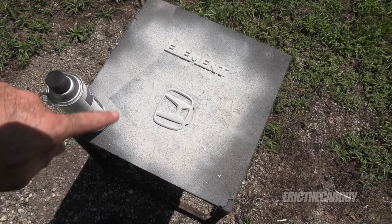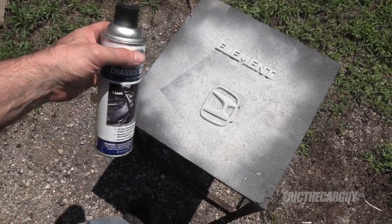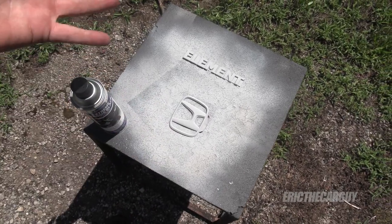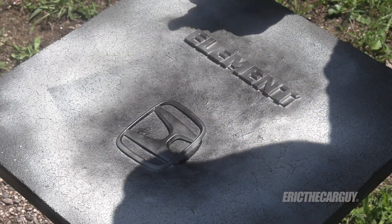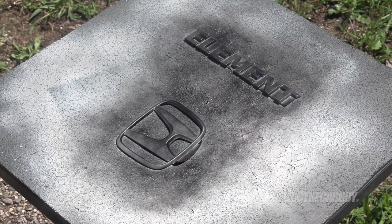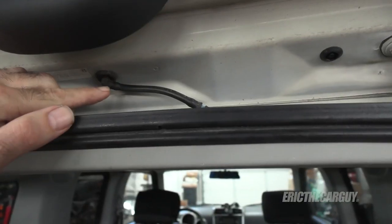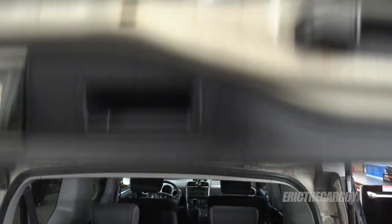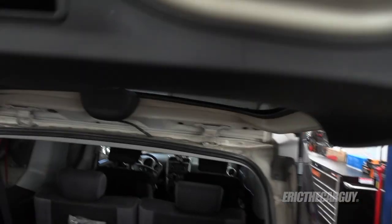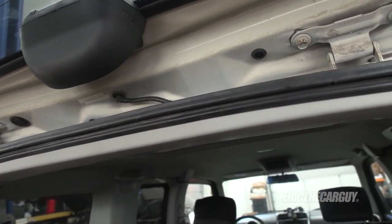In between doing that, I came out here and put another coat of primer on and everything looks good. So I'm going to be doing the chassis black for the final coats. Same thing as with the primer — light coats until you get the thickness or pigment that you want, but don't try to goop it all on. Every once in a while, I'll turn the can upside down and clear out the tip so you don't get little spitty bloopy things. I'll let that dry and keep adding until I'm happy. Now I'm going to start masking things off and getting things ready so I can start sanding and then painting.